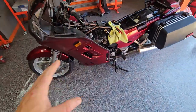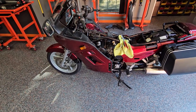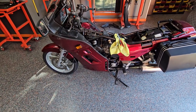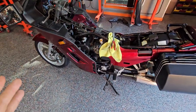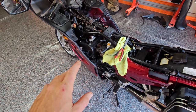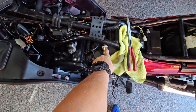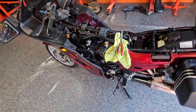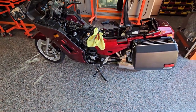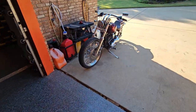I'm going to polish up the bags and put them back on it. The Concours — I've got a weird issue going on right now where it's hunting at idle and it's got a kind of weird off-idle bog, then it goes away and kicks in like there's a turbo. So I've got some kind of fuel starvation issue going on. I'm suspecting maybe it's the inline filter — I might have to pull the carbs back. But other than that, this bike has been a long road, so that's kind of the last stage for it.